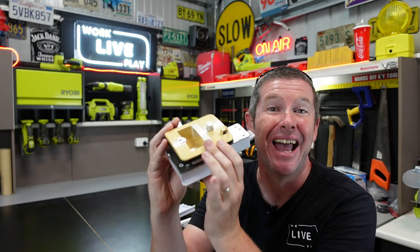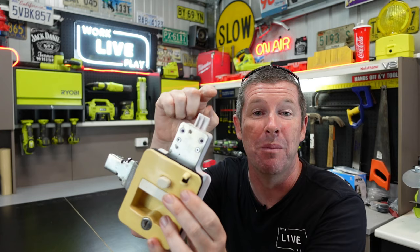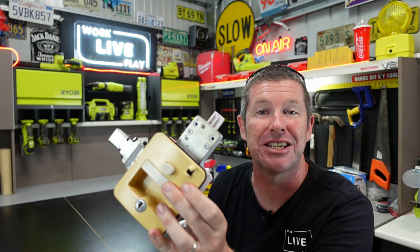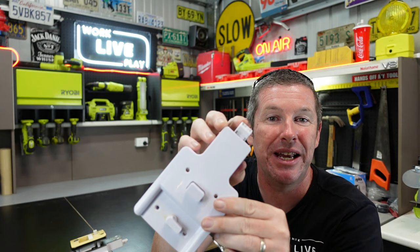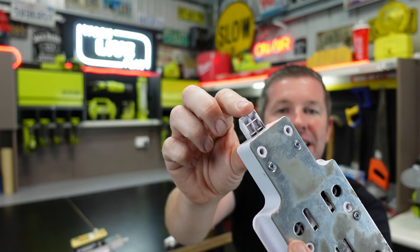The snib is a common failure point — these snibs have a tendency to snap off. If you're in the middle of nowhere, that is a bit of a problem. People come up with some ghetto fixes, putting wood screws into the end of them just to try to keep the door closed. These are a weak point of the latches and really should be fixed. A few of these snib issues do come about from poor adjustment and the door getting out of alignment, but the inherent issue is the weakness of this snib — it's hollow inside and not solid all the way through.